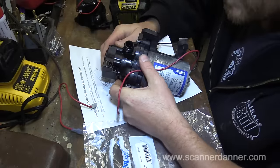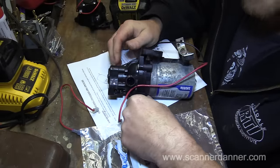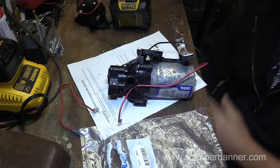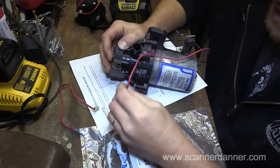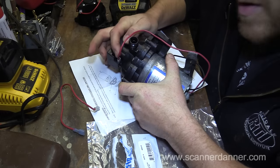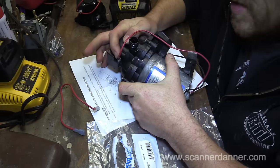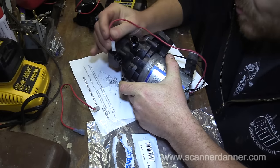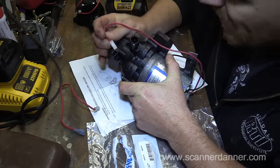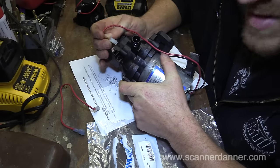Let's talk about the switch here for a second. In the automotive field, I see this all the time, where you go to a connector. If you guys remember, on the video I was pushing on this lead right here. And so what that suggested was a bad connection between the two, and unplugging it, plugging it back in seemed to fix it. And it did for a while.